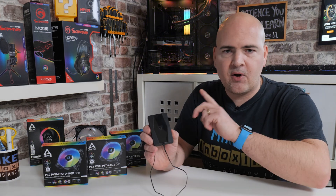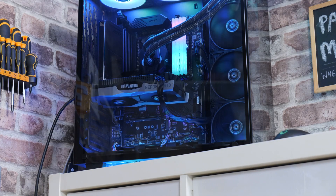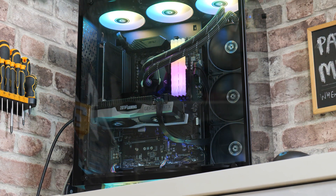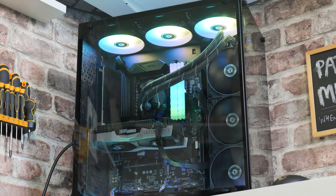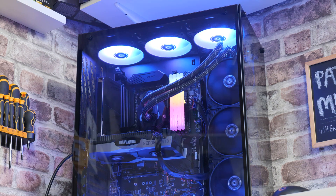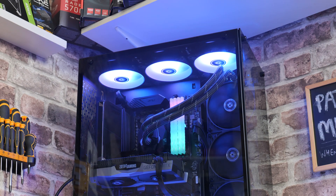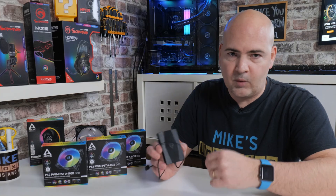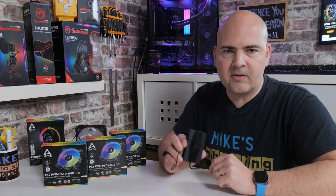Let's turn off the PC and disconnect all the fan headers from around the motherboard. It actually has six headers, but that means cables everywhere. I've daisy-chained the fans in the bottom and the top — three fans plugged into one header, three fans into another — which I'm not entirely keen on. I want to add more fans to the case and the radiator at a later date, so this gives us future-proofing. Or if you're using a case like the Lian Li O11 where you can fit an absolute ton of fans, you could put all your fans into this and not worry about straining your motherboard.